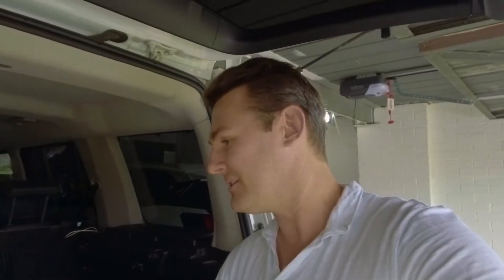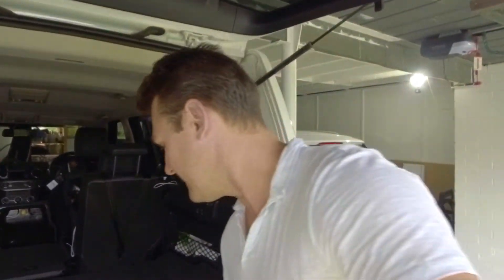So I decided to hook it up to the main battery. After hooking it up, there was no charge going through. I was scratching my head figuring out what was going on. I got home and figured out that the safety switch was wide open — I had it in the open position for my own protection and the vehicle's protection, but hadn't closed it off. Lesson learnt.